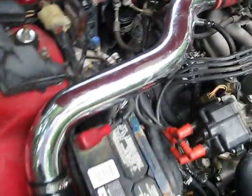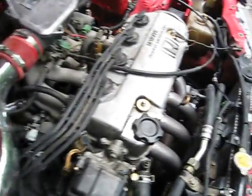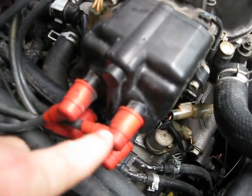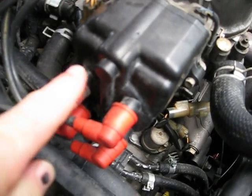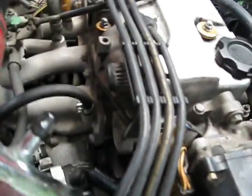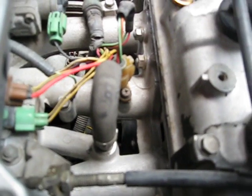You're going to move your intake and remove all your spark plugs. I marked every one of them as to where they go in series. Then step back here — you can see all the bolts that hold your intake on and remove all of those. Right next to that pipe down there there's a tricky one; you're going to have to get that from underneath with a long extension — probably about three extensions plus the ratchet or breaker bar.